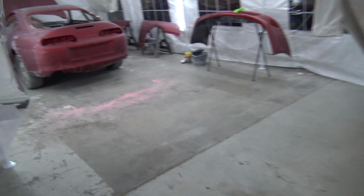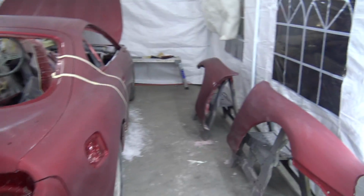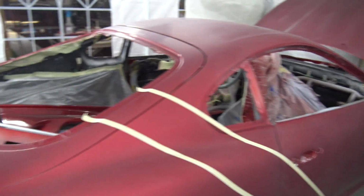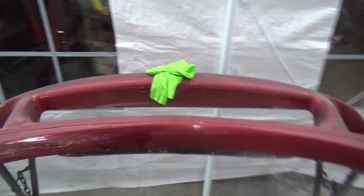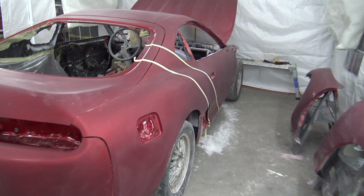So we'll go ahead and get it backed out over here, pull the doors off, scuff the back of them, at least for the door jamb portion of them, and then do a test spray in the booth with the front bumper, the hood, the fenders, and the doors, and then hopefully everything goes well, and that's just going to be that black color. Even if we do get a little bit of stuff in it, shouldn't really matter a whole lot because we will be able to cut and buff it out pretty easily. And then after that, probably not tonight, but probably the next video you guys will see, we'll be actually painting the rest of the car. So let's go ahead and start moving stuff.